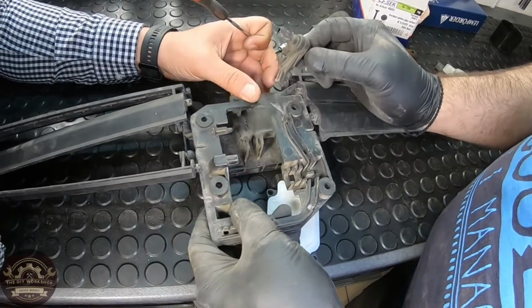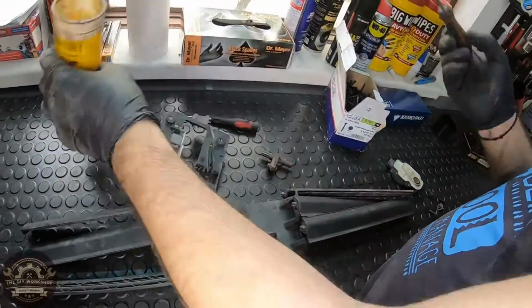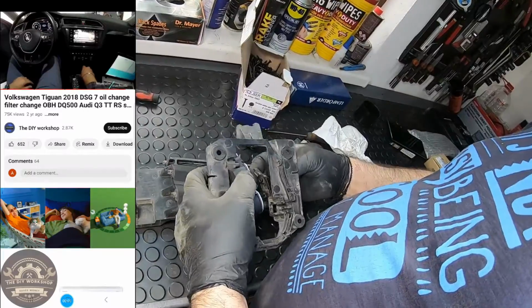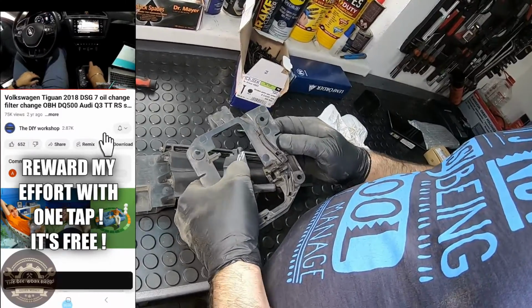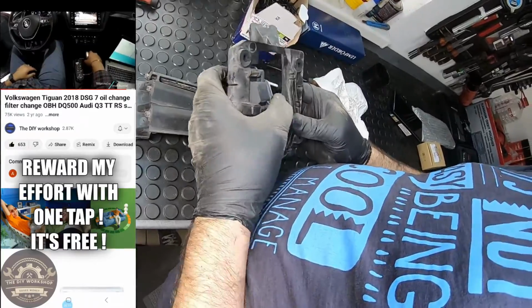When we place the motor back in, we approach this in a slightly different manner. We first took out the mount. We applied some grease to the plastic arms and to the shaft so that it slides back in easier. We then transferred the shaft to the new motor and attached both of them to the mount.